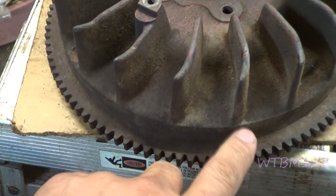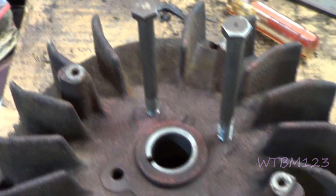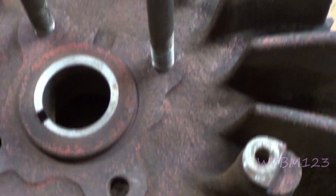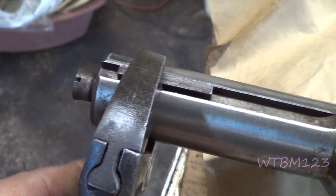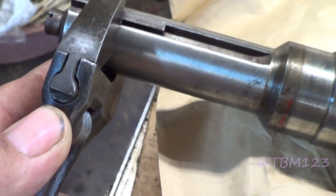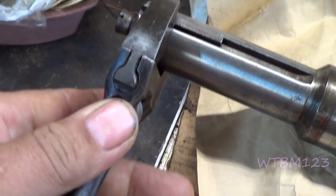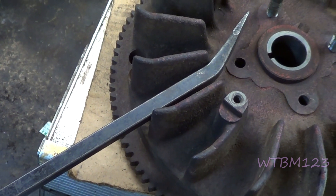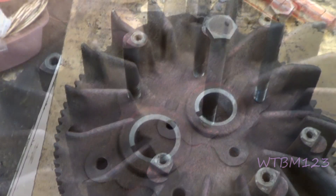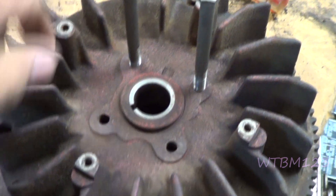They have flywheel holders. You could put a belt or something around the outside and hold it, or you could run these two bolts in and put a bar in here. When you put the flywheel on and you've got to tighten it down, put the proper keyway in and put a crescent wrench on there — it'll grip. The crescent wrench really doesn't do any damage; if you're worried, put a rag under it. The thing you don't want to do is hold the fins — it's tempting, but what usually happens is missing fins. These bolts could bend on you, but even if they bend you can usually get them right back out. Just don't break your fins off.